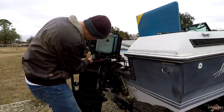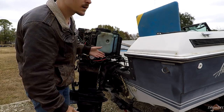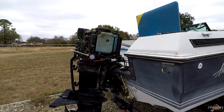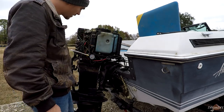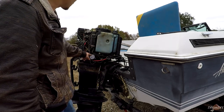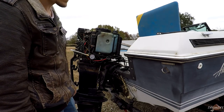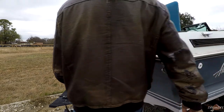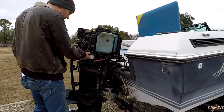So now it's engaged. Let's check here — it's looking like we're at 90 PSI, which is within the margin of operation, but I'm going to crank it over a little bit more and see if we can get that a little bit higher. So that one's stuck at 90 — that's still reasonable. I think 60 to 70 is when you get real worried. If we let the motor run a little bit it might actually fix that issue. On that one we're running about 90 as well. Good news so far. Now let's check the last one.